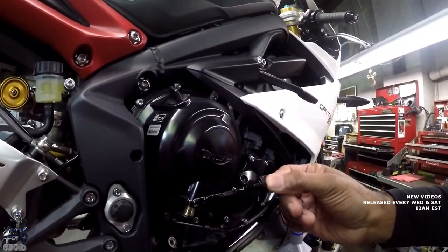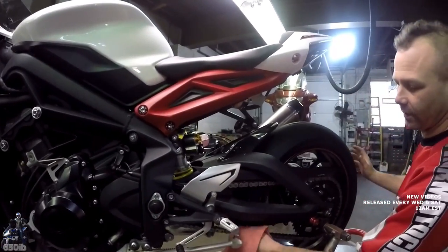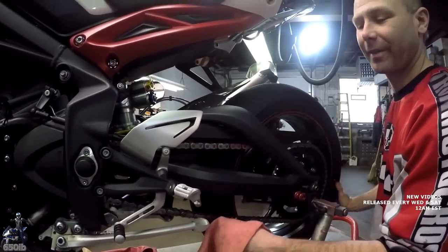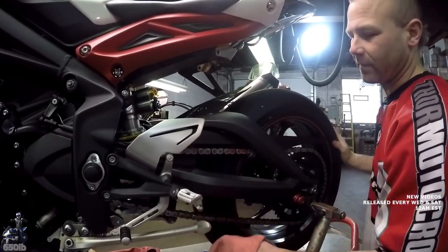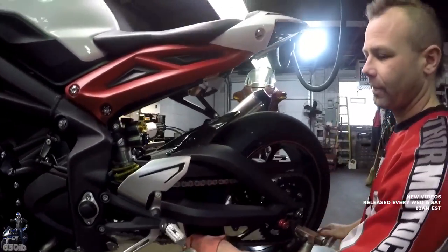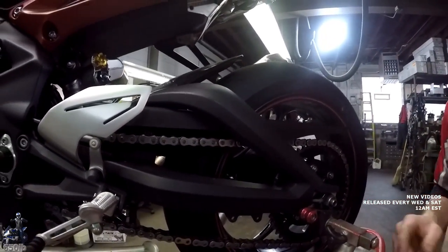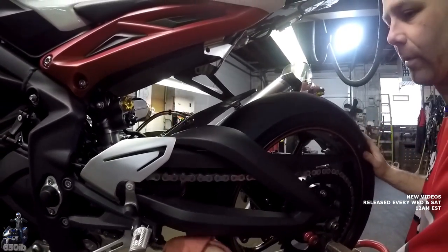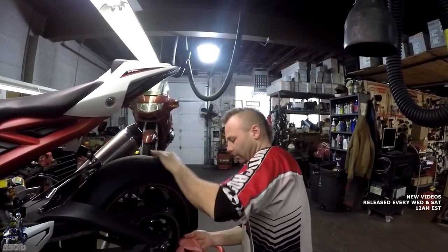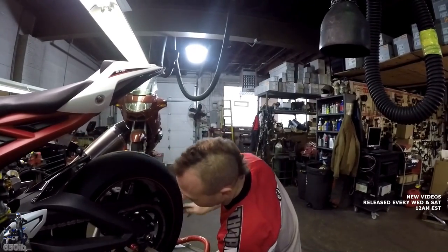Perfect — we're right before that max full on the oil level. We'll wipe off the old grease first, then check chain play on the rear stand to confirm that same amount of free play. This actually has a little bit more right there — that means tight spots are starting to develop in the chain. The pins stretch in certain parts of the chain when you accelerate. The chain cleaner should do its thing — wipe off the old stuff, and make sure you keep your hand out of the way of the sprocket.